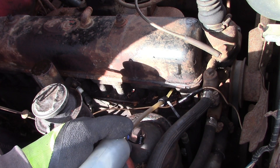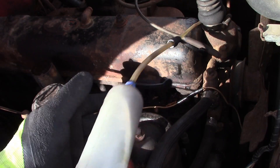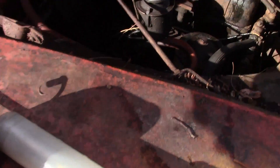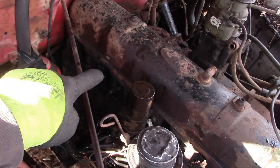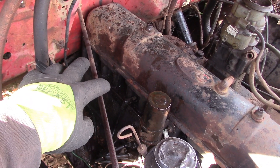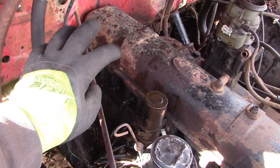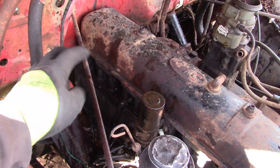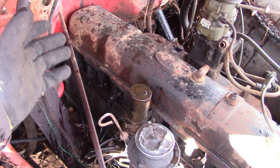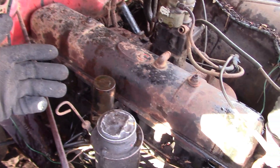Well, that's not a good sign — that means the Evapo-Rust never made it past the rings, so I don't think we ever had a chance. Cylinders number 1, 5, and 6 were still clear full, which means the Evapo-Rust never made it past the rings. That's the exact same thing that happened with the diesel fuel ATF mixture — it never made it past the rings. So, can Evapo-Rust unstick a stuck engine? Maybe. But not this one.